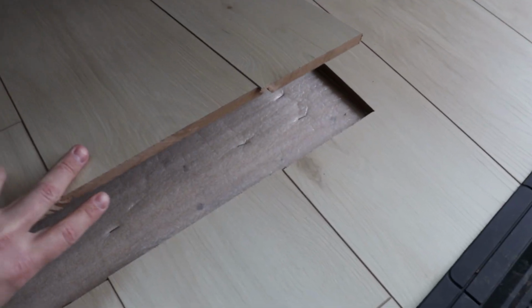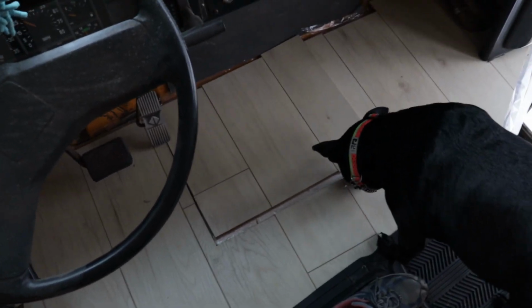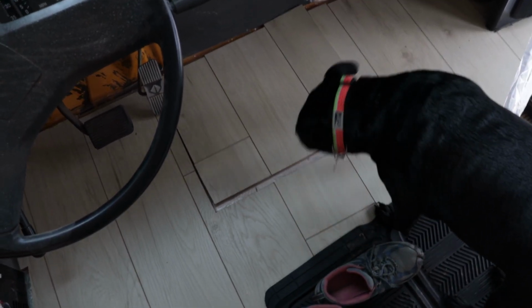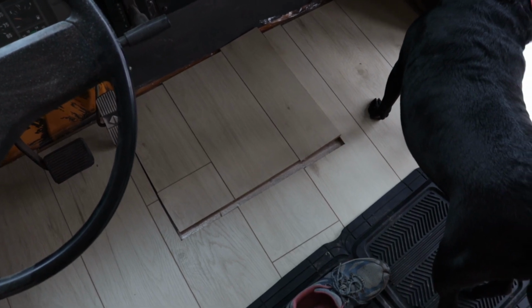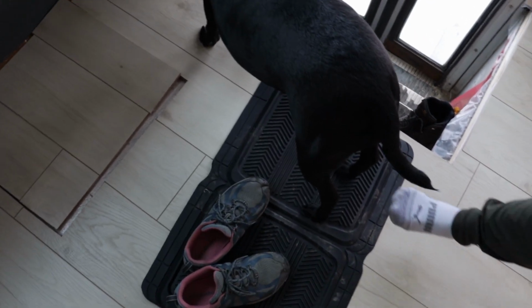And one more thing, up at the front of the bus up here, there is actually this false piece of flooring. So yeah, it looks pretty awful right now. But what's under here is actually access to the transmission. So what we'll end up doing is we'll actually probably put like an 1/8 inch piece of paneling or something on the back side of that and glue all of those pieces to that piece of paneling and then screw it into the floor. In case we ever have to access the transmission, we can lift all that out pretty easily without having to take out the entire floor.